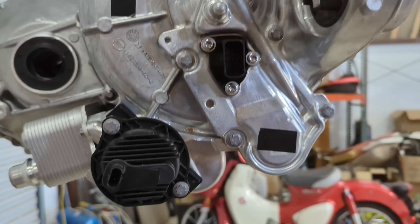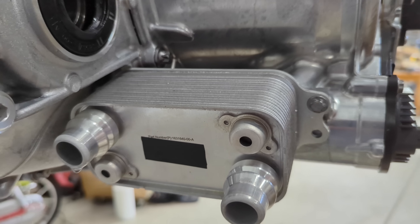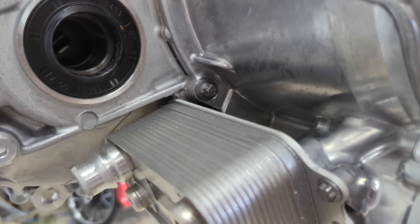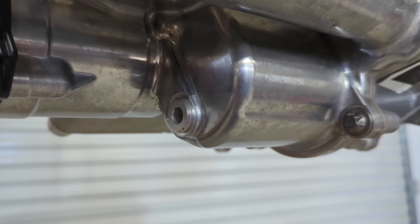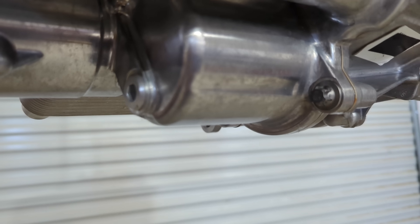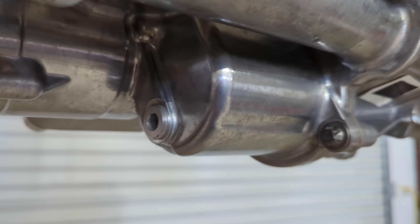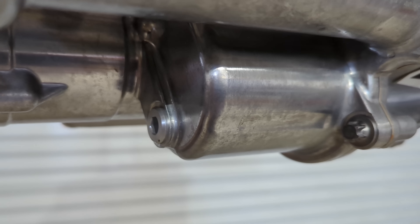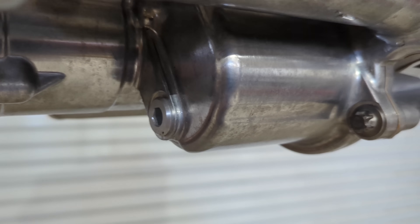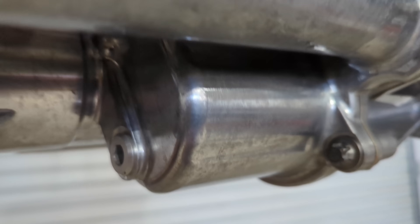We've got the encoder back here, the same oil pump, and a stack plate heat exchanger that cools the gear fluid. Underneath here there's this big long tube — this is where the cartridge oil filter is. It's no longer a spin-on or user-replaceable, but it doesn't really need to be replaced for the life of the car anyway. This isn't like an internal combustion engine, so that filter is just there to stop small wear debris and maybe manufacturing debris — it never needs to be changed.